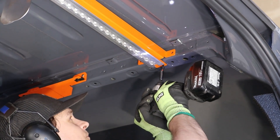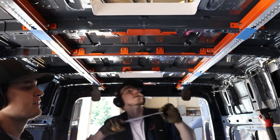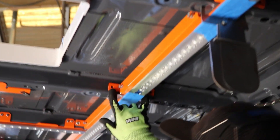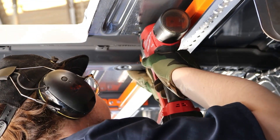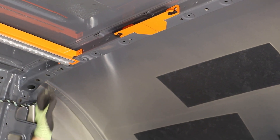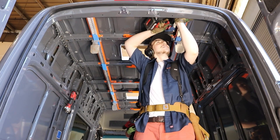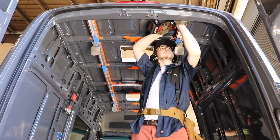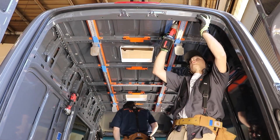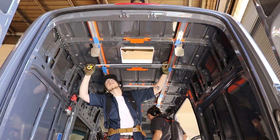The forward rib on the ceiling bracers has a little set screw hole on the tab that sits on the face of the rib — use this to make sure the ceiling bracer is nice and secure and flush with the ceiling rib before setting your quarter-inch rivets. Set a rivet on one side making sure the bracket is pushed flush with the ceiling rib, then move to the other side. Measure at every step. After your center line points are attached, move to any of the other ceiling ribs, continuing to measure throughout. Once you have two ribs set separated from one another, your ceiling bracer should be pretty parallel. Then go ahead and set the rivets in all of the little brackets along the ceiling bracers, using rust prevent and keeping everything flush with the face of the ribs to follow the contour of the van.